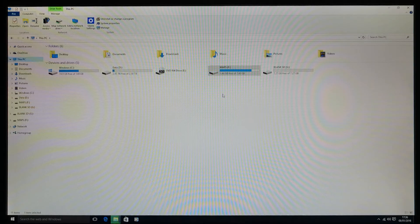On the new Zumos, the device operates in MTP mode — Media Transfer Protocol mode — most of the time. We need to change that to mass storage mode just for accessing some extra files within the Zumo. To do that, turn your Zumo on to start with.